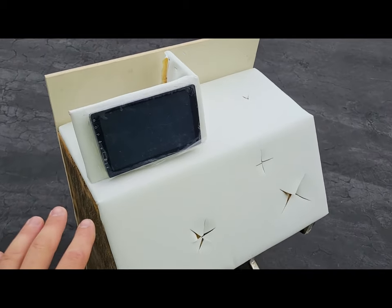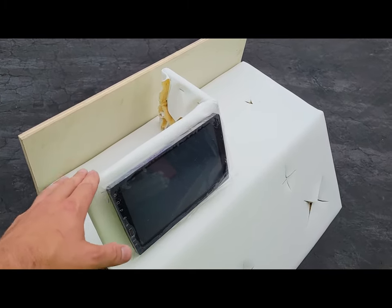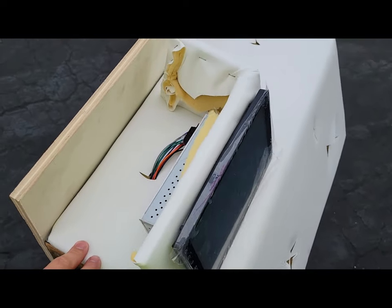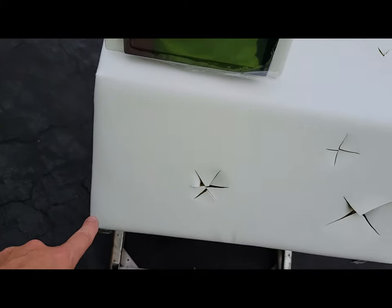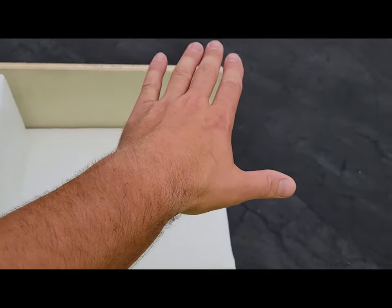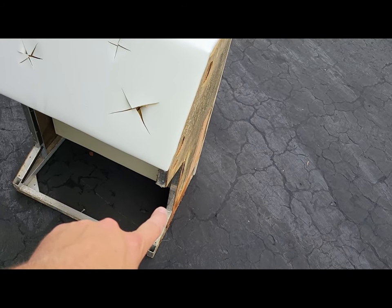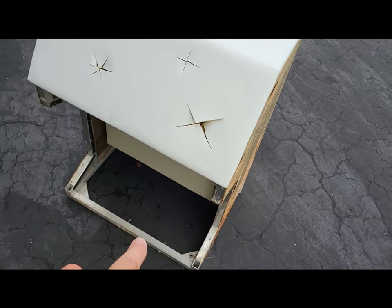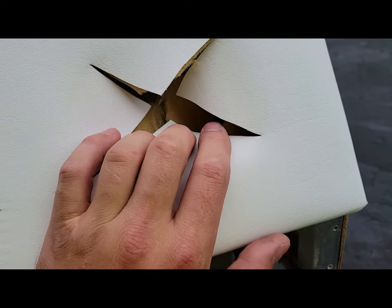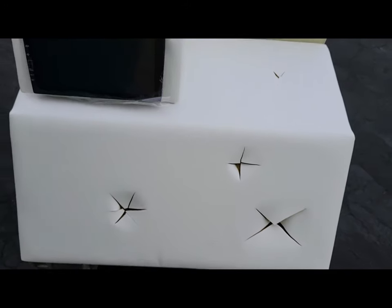So there — we got it temporarily sitting on here. We went ahead and nailed on the head unit bracket with the nail gun. If you look behind it, we have a hole so the wiring will run down into the fuse section. All that's left to do now is screws in the back corners, put the nuts on the front fascia to bolt it down, and everything else is going to be modular as well — side panels will fit over to cover everything, top panel, kick panel, and face panel. The face panel here will use heavy-duty Velcro so it's removable, because our amplifier will be mounted on the back of the box. We still have to put in our switch panel, GPS speedometer, and the steering wheel mounts here.